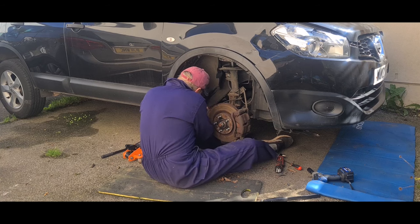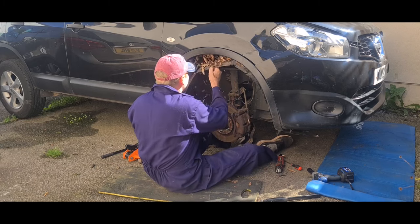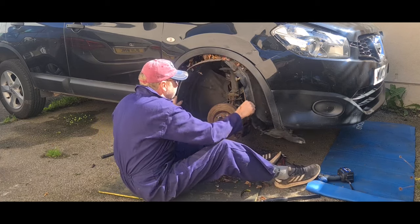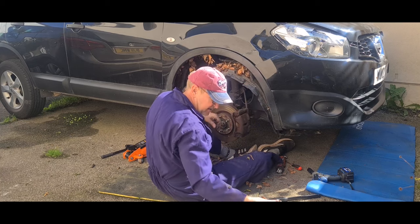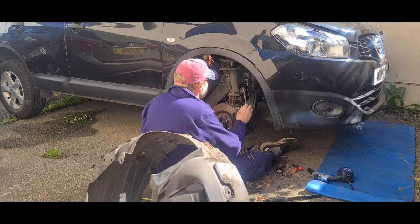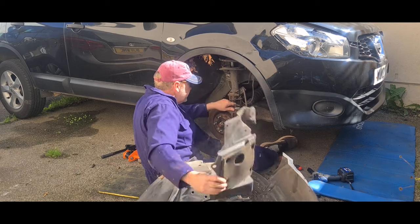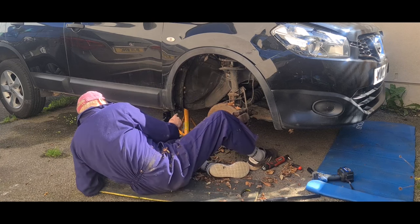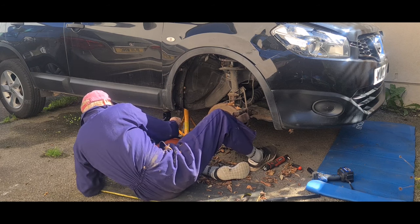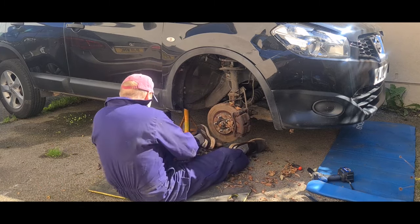This video will actually help out people that haven't found a video on how to take a wing off a Nissan Qashqai — we're going to have to make our own, as simple as that. I couldn't find many videos generally speaking on salvaged Qashqais. Do try not to break these little clips because they're a bugger to get hold of. And that is the arch liner out, along with half a tree by the looks of things. It's going to be fun. Now, getting this wing off — I'm assuming exactly the same way as the little Corsa. Two little bolts just down here covered in crap. Getting that mastic off is never an easy job — the hardest job I've done so far on this car.